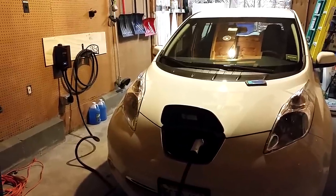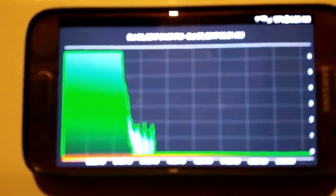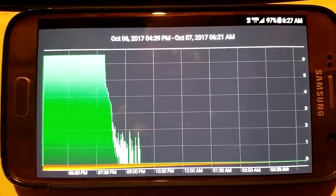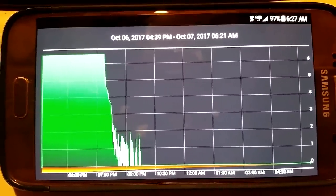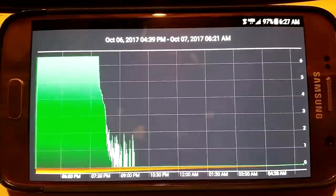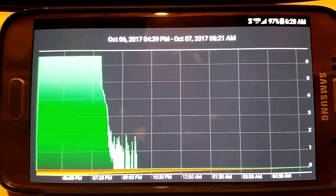And here we go — it's the next morning. You can see I'm still plugged in but I'm not charging anymore; the lights are not blinking on the car. I've got my app open here on my cell phone. I had plugged in yesterday afternoon at 4:30, and as you can see, this was done by 9:30 — so five hours to fully recharge from 21%. At about 7:30 is when it started going into its trickle charging mode, and for the next two hours it was basically just topping off the car. I could have unplugged at any point and I would have been fine. But now it's at 100% charged and it's conditioned the battery.